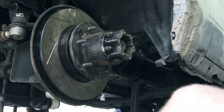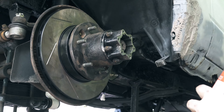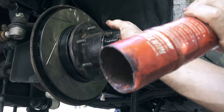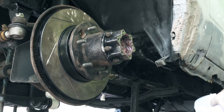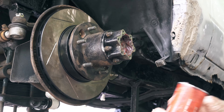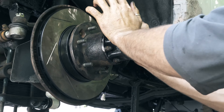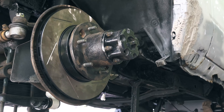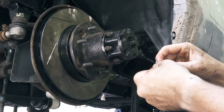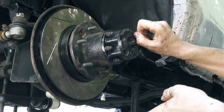The other side is on. Now I have to get this c-clip back on — I won't embarrass myself doing that on camera because it'll probably take a while, so I'll be back in a minute. Got it! That's crazy — yesterday it took about 20 minutes, that one was about a minute. Anyway, I just packed a bit of grease into the end of this hub and into the other one, and then I'll install that and put the last six bolts in. Once she's on, I'll use my 10 millimeter socket to do them up and we'll have a new rotor.